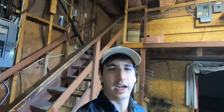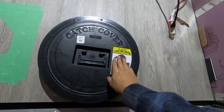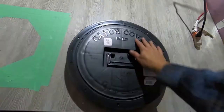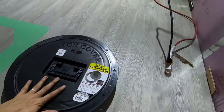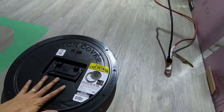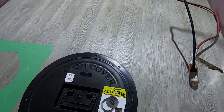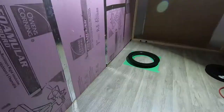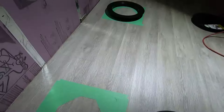Oh, I'm an idiot. Catch covers — what are those? Essentially, they are a product for ice fishing. This is the original catch cover. It's basically made out of a heavy-duty plastic that won't crack in extreme temperatures, and it is durable enough to run a four-wheeler on top of them and walk on top. So I opted to install these — or I'm going to be installing these, or attempting to install these — in this trailer build, because I would like to bring this thing ice fishing. So I ordered two catch covers; they are a 12-inch hole diameter and 12 and 3/4 rough cut in the floor opening. I've kind of laid them out roughly where I want them and taped the floor because I will be cutting this floor, and I want to avoid scratching and damaging as much as possible.